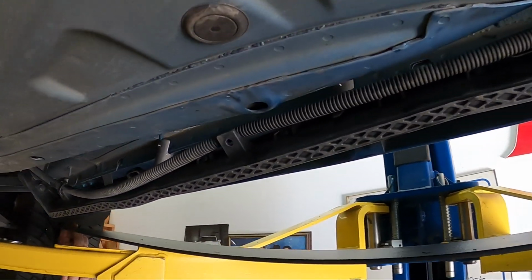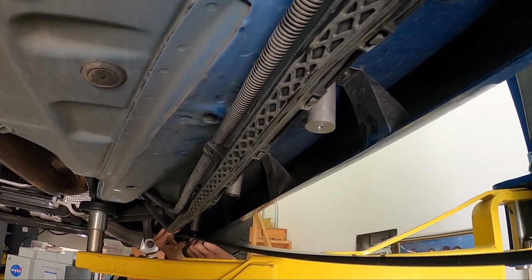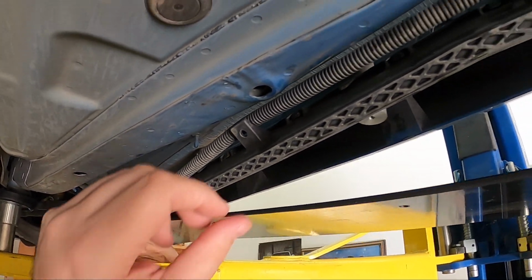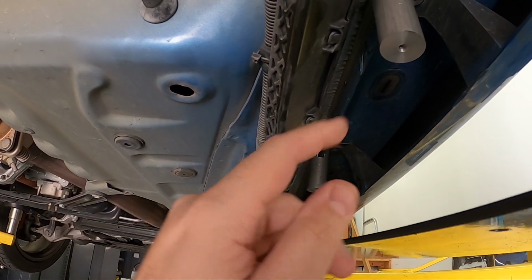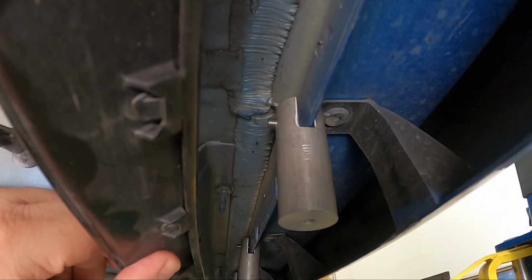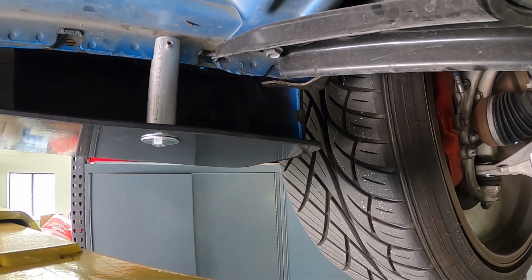Now in this instance, on this Durango, and we believe on all Durangos, there is a fuel rail on the passenger side. There are 3 or 4 nuts that hold it in place. You'll need to loosen those and remove it, and it will just hang down in position so you can properly get the hardware installed.